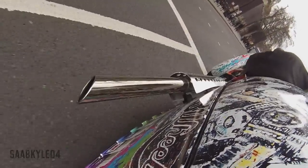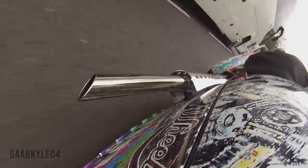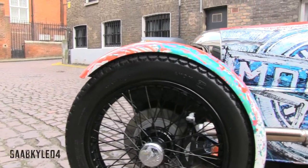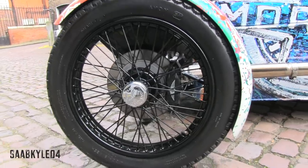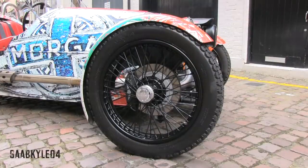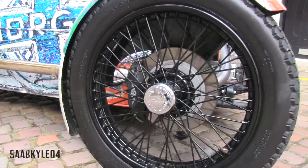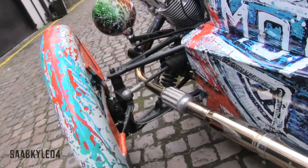Morgan also broadened the customizability with new colors, combinations, materials, accessories, and more. Subtle vertical vents were added in the rear bodywork inspired by its historical predecessors. Morgan also provides a 30-month or 30,000-mile warranty. The three-wheeler features black wire wheels up front reminiscent of the original style, shod in vintage-looking 19x4-inch Avon 65 Series Mark II tires, finished with hub-mounted cycle fenders. The rear is a bit more modern, consisting of a 16-inch alloy wheel and 195/55 Vredestein Sport Trac 3 unidirectional rubber, able to hold around 0.75g of lateral acceleration. For its time, the three-wheeler set many racing records in its category, some of which still hold true. The brakes consist of 280-millimeter internally ventilated front discs with aluminum calipers, while the rear has a 250-millimeter drum brake.